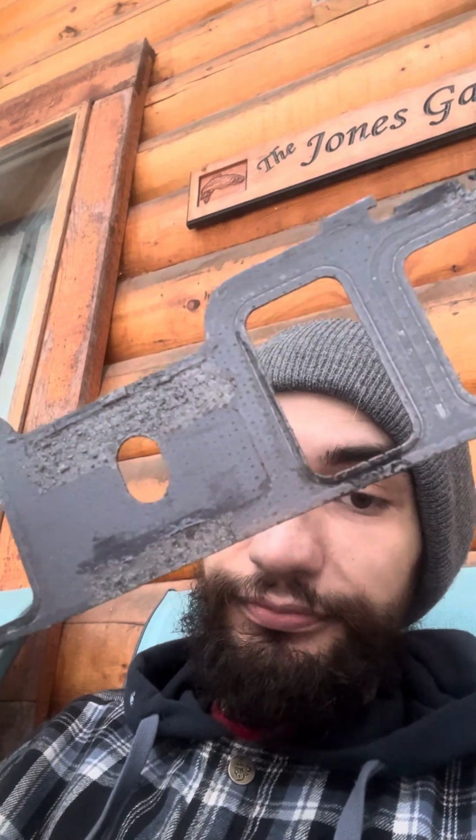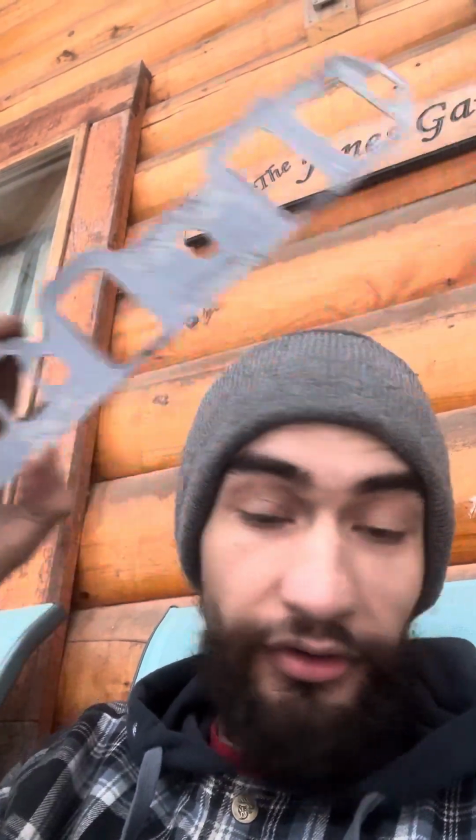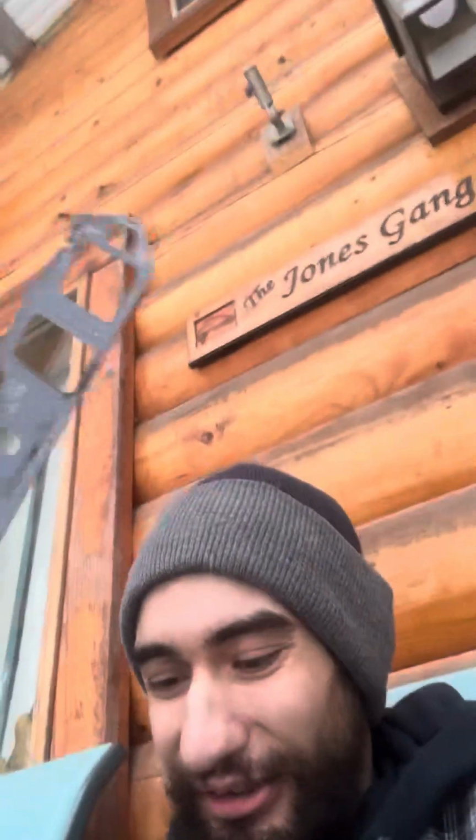Anyway, you just got to replace them, especially with aluminum heads. Aluminum doesn't expand at the same rate as iron. Head gaskets weren't otherwise in too terrible of shape, right? But I've also gone through 3 sets now of Felpro intake manifold gaskets. I honestly would have probably been better off literally just putting the gaskets that I originally had on here, that I tossed out, back on.